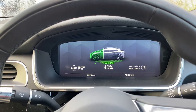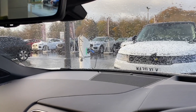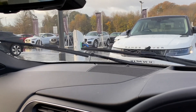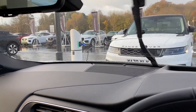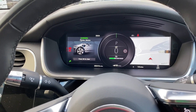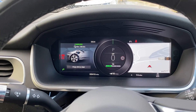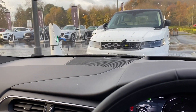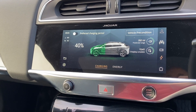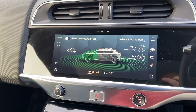What a difference — 6 hours 38 minutes on the 7kW post, compared to 21 hours on the 13-pin socket. If this were an 11kW post you'd get an even quicker charge. Fast charging at 50kW — and now up to 100kW — will change this massively. People with battery anxiety and charge-time worries will see that change as manufacturers and charge network providers push forward. From 21 hours down to 6 hours is a huge improvement. Now let's plug into the 50kW system — it works slightly differently, you need a card for that one.